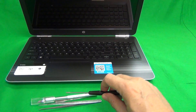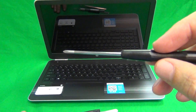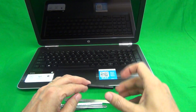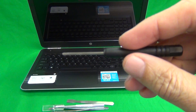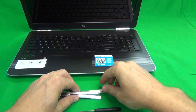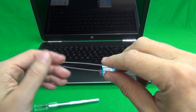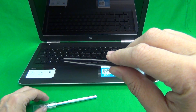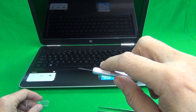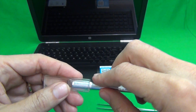Next, we're going to go over the tools we're going to use. We have a PH1 electronics screwdriver — PH stands for Phillips, and 1 is the screwdriver size. We have a smaller PH0 electronics screwdriver. A spudger for prying things open. A pair of metal tweezers to remove any screws that may be stuck or for manipulating things. And finally, a hobby knife or X-Acto knife, and that's to lift up adhesive tape.